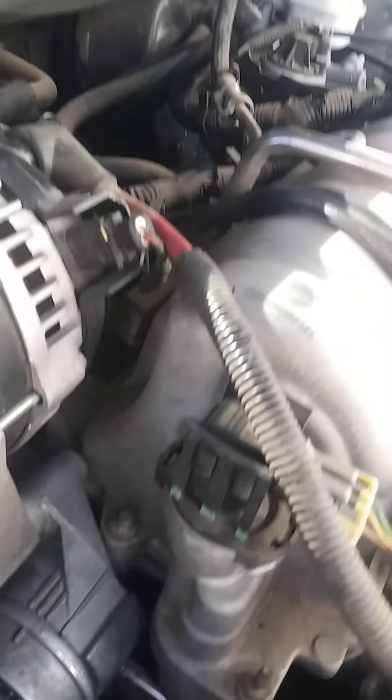You can buy heater elbows at O'Reilly's — they're about $18. Get the metal ones. With everything off and cleaned up, dried nice and neat, you're going to put RTV on the inside of the hole and on the elbow and then push it inside. The bigger elbow — the same length 90 degree angle — goes on this part right here, and the smaller one goes down there. There's only one way to put them so you can't really get mixed up. Put RTV on all the places that have gaskets.